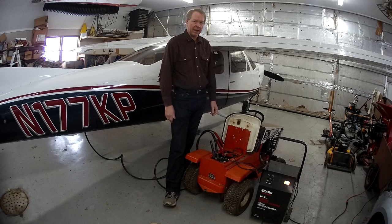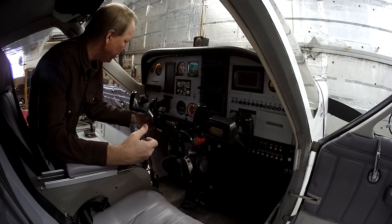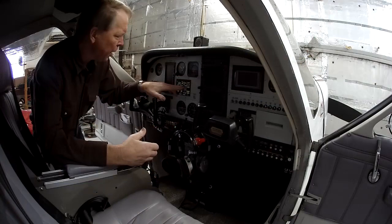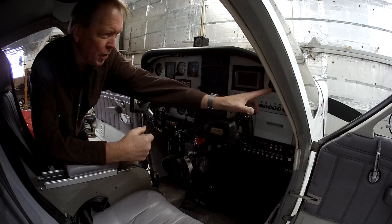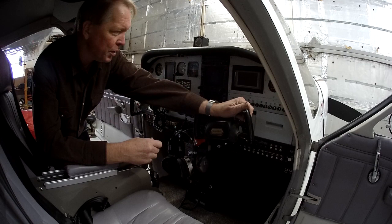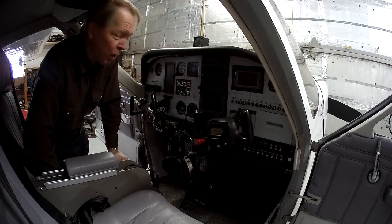We'll go into the cabin now. We're in the cockpit — as you can see, the lights have come on. The airplane is powered even though the master switch is off. I can monitor the voltage right here on the JPI: it's about 12.6, 12.5 volts — a pretty good number. I can also see the voltage on my ship's battery on this other instrument, which is not connected to the power I'm running. It takes less power than a running clock but always tells me what the voltage is. I'm going to turn off a couple of things we don't need — the fan and the audio panel — and then we'll be ready to turn on the Avionics Master and start loading databases.